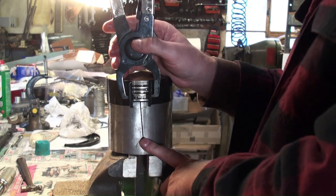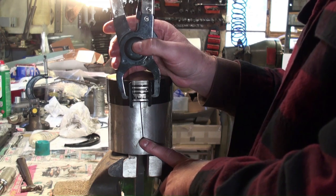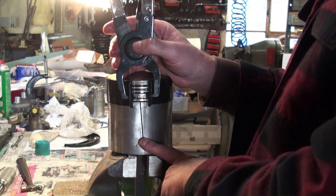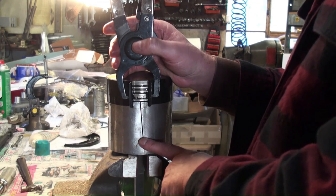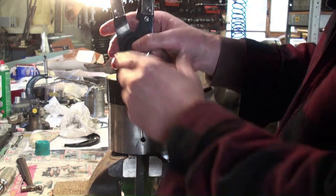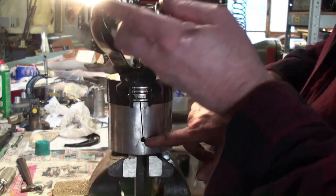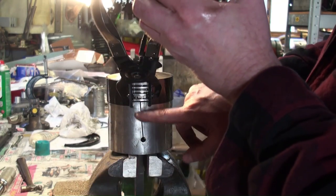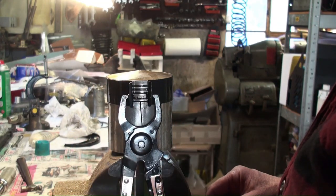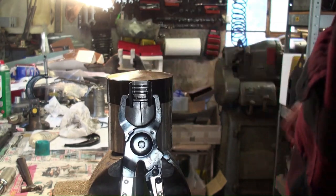Oh, also, this is the split of the piston, and this is on the non-thrust side of the engine. On this particular engine, Springfield Phantom 1 Ironhead, that is on the driver's side. And so I positioned the clamping part of it in alignment with this split, because that's where you have room with working with the studs. So you just make sure that's all on there nicely.